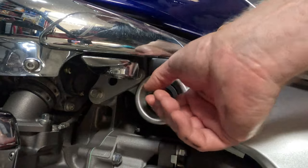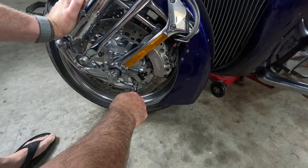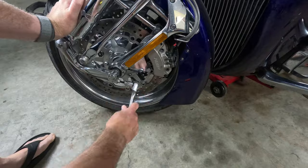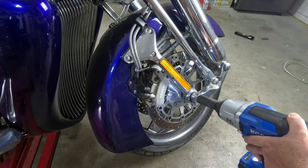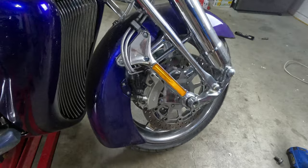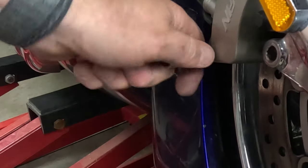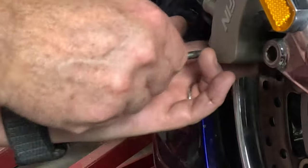Let's kick this up a notch and get those wheels off the ground. We've got to start by loosening the pinch bolts to yank out the main shaft. Pop that cap off, hit the last pinch bolt, whip out the trusty power torque wrench for the heavy lifting, and unscrew the shaft bolt. We're moving the brake pads aside to make a clean break for the wheel.